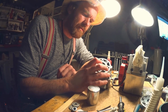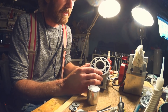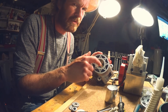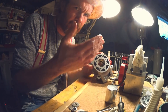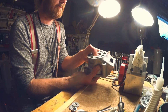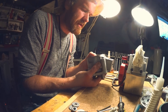In my design there's a big radius — kind of a bevel, chamfer, whatever you want to call it — at the exhaust top edge. That is needed with a normal piston ring and a bridge, because it's so wide, and it helps with gas flow. I remember how stupid I felt when I forgot to put that chamfer in before I plated the cylinder. And I feel stupid now for not having it there, because now with just a slight chamfer compared to what's supposed to be there, it works. There's some resistance, but with a better chamfer, I'm optimistic again. Hooray.